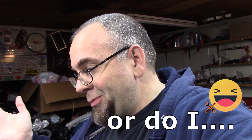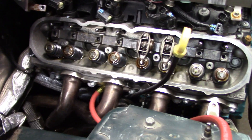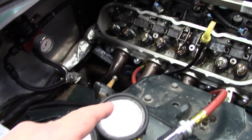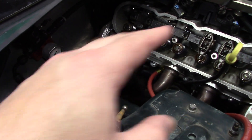If it has higher leak down — that's only five percent leak down — but still, if I'm looking at an engine and it has more than 20 percent, I probably don't want it. I should hopefully be able to tell that real quick. I don't really have an engine that has 20 percent leak down to show you. I decided to try at least one more cylinder before I go off to test that engine I want to buy. I've confirmed that with both compressors, five percent leak down. This front cylinder I know is like 55 percent — I'm not even going to bother to try with this little thing. But with my other compressor I tested this other cylinder and it held at 20 percent. Now I've already tried this with the little compressor, and while we know it won't keep up with five percent, it's definitely not going to keep up with 20 percent, but we want to know if it will at least show us.